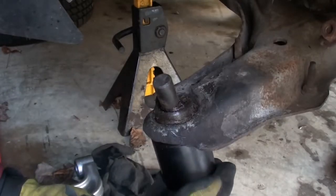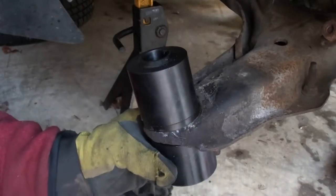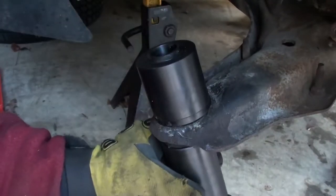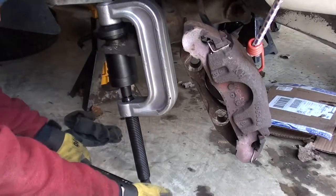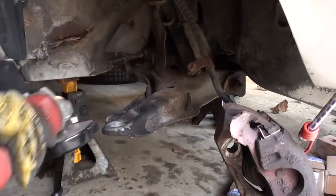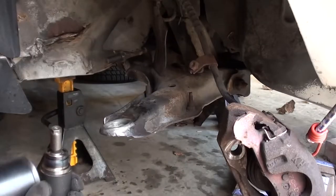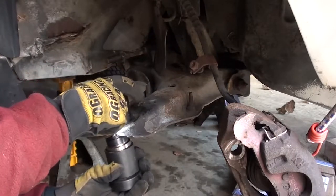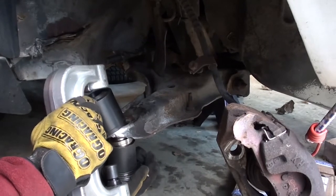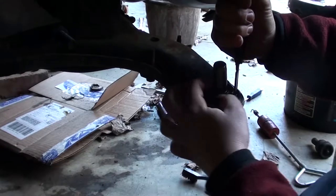After really messing with the other side and realizing that this presses down instead of up, I had a little bit more luck on this side. If you ever use one of these ball joint press tools, it's a matter of finding the right set of spacers and caps, then taking the clamp and pushing the thing out. It takes a few tries to get it right, but eventually it'll make sense and the thing will just come right out. Put in the new ball joint — it's just the reverse of taking the old one out. This one actually had a C-clip on it to hold it in place, which makes sense. The other one I took off didn't have that, which was kind of strange.